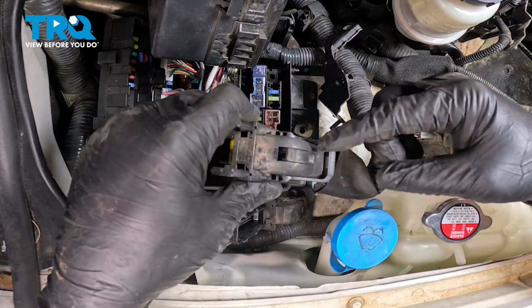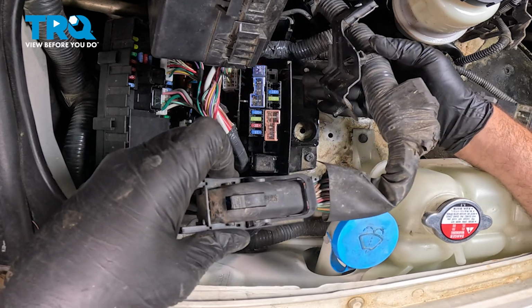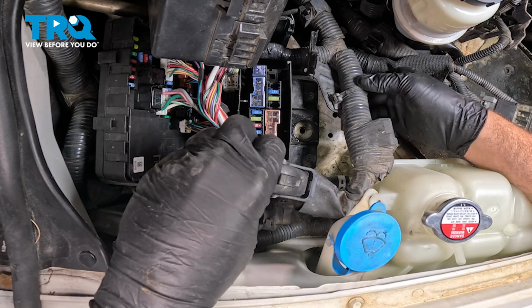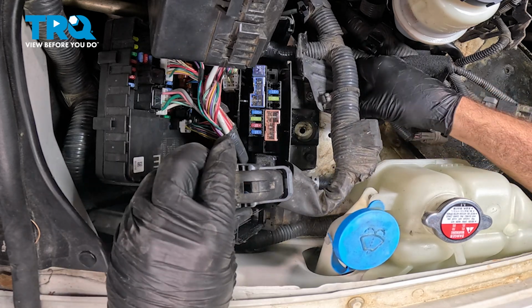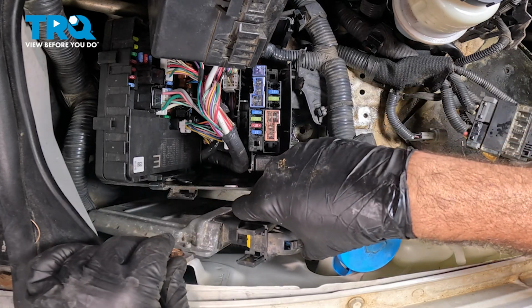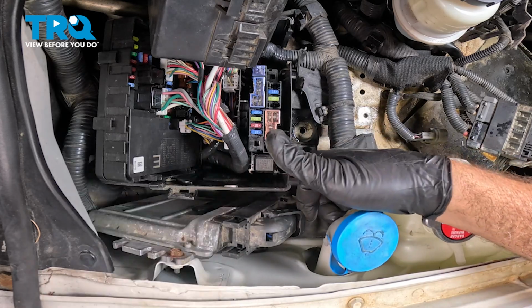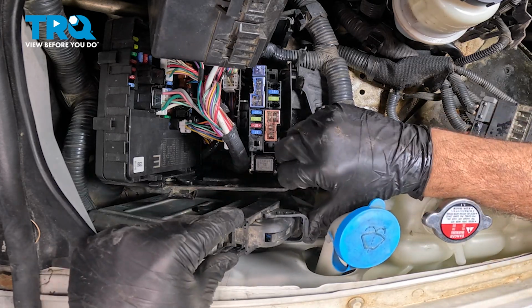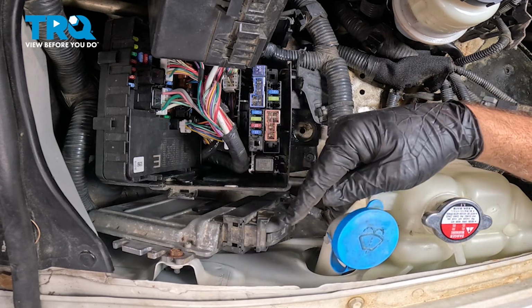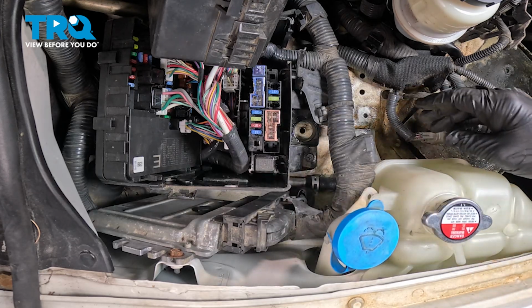We're going to repeat the process for this one as well. But you also want to pay attention to the harness here. We want to make sure that this bracket is flipped around properly, as this needs to get fit into the fender well as you're doing this. Bring this connector over, line that up. Grab this here, and you can actually watch these 2 tabs. Sucks them in, and it's going to go just beyond this little lock tab here, so you know that these two connectors are secured.